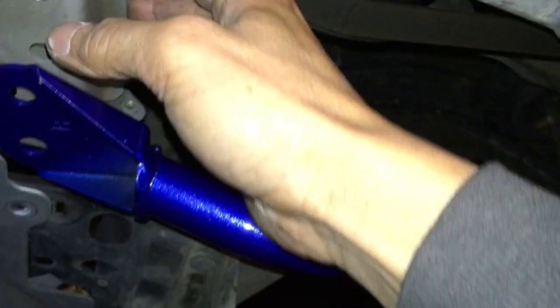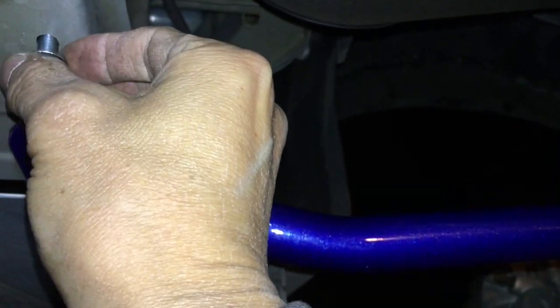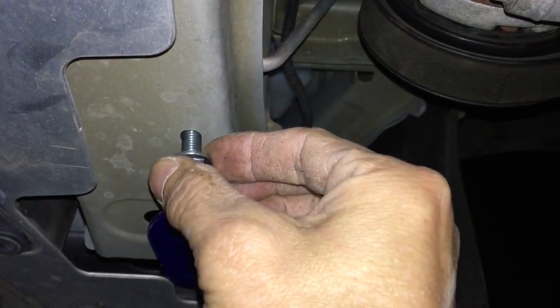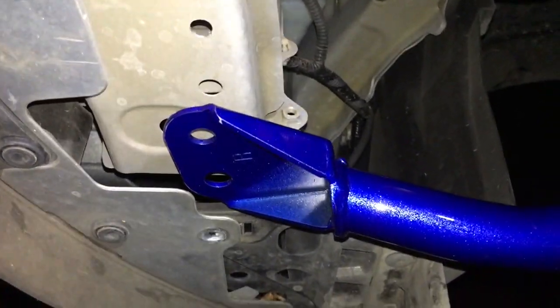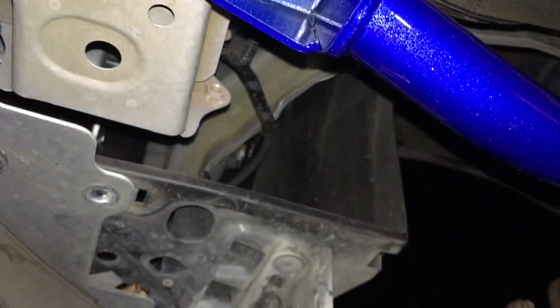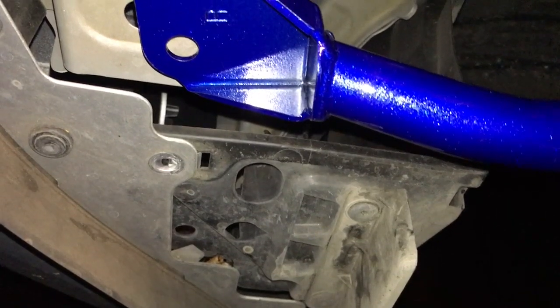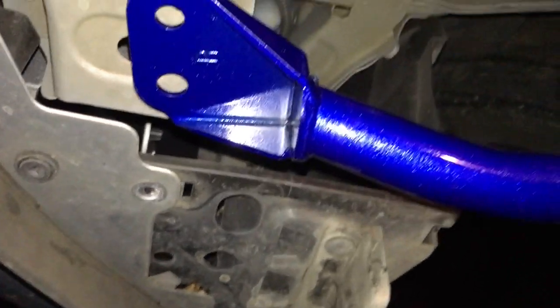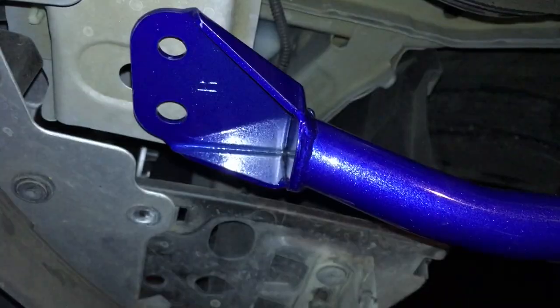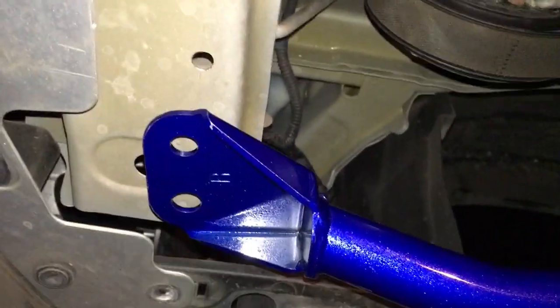After I did that, I took a little 1/16th drill bit and drilled a little pilot hole. Then I took the drill bit that's basically closest to fitting this, so I have enough clearance. There's not that much wiggle room, just a little bit - like this bolt over here. I maybe should have used a tighter drill bit. Those bolts I think are metric, and what I'm using is fractional inches, so it probably doesn't quite fit the same.